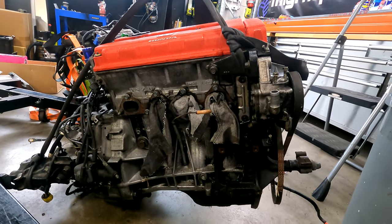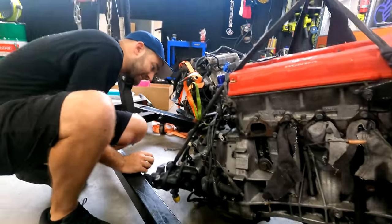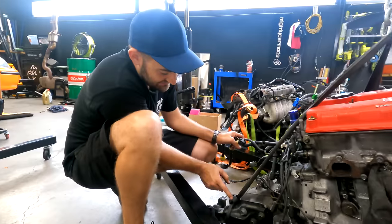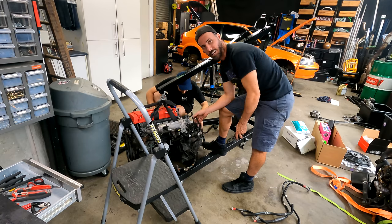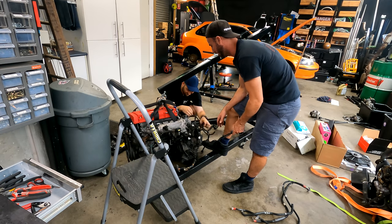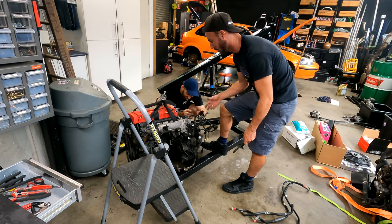What we need to do is get this gearbox off. That looks like a mad fight, but that's what we're going to do. We're going to remove the gearbox. I remember this game from last time. We're going to have to move this strap because that's on the gearbox. Okay, so the next job, we're just going to strip everything off the engine, get rid of all of this, all these wires, get it gone, then get access to the gearbox, take it off, put the clutch in, put it all back together.